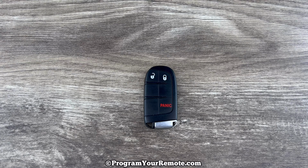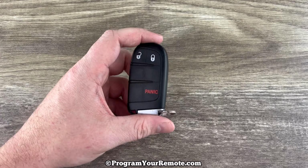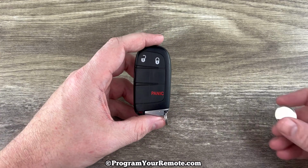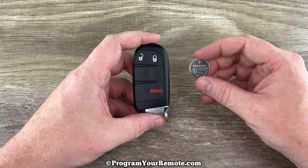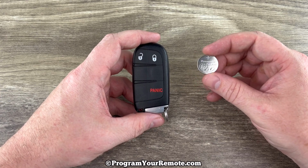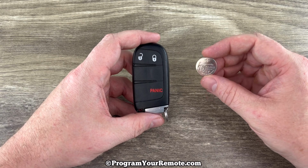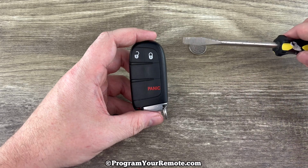Today we're going to take a look at how to replace the battery in this Dodge Journey key fob. This key fob is going to take replacement battery CR2032, and I'll put a link in the description box of this video to where you can purchase these batteries if you're in need. The other thing we're going to be using is a flathead screwdriver.